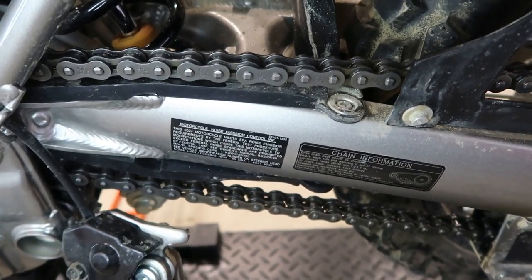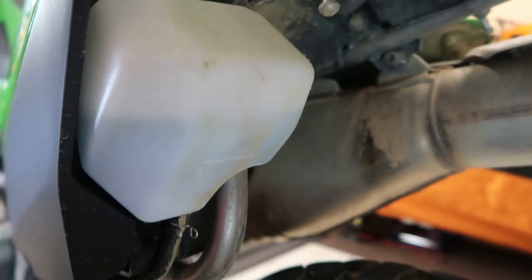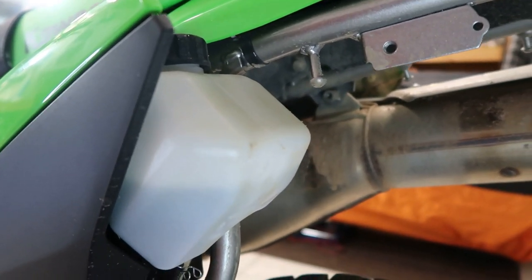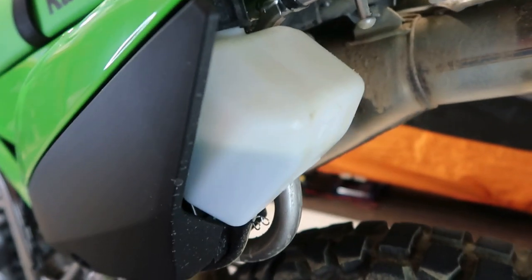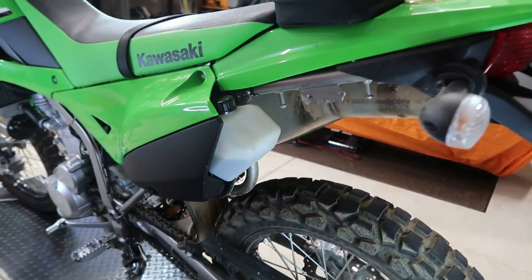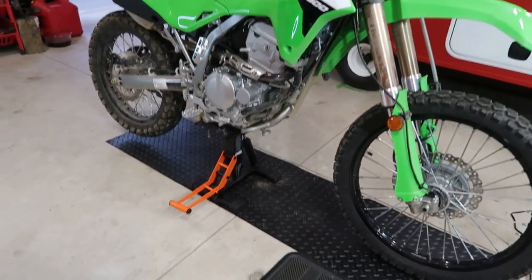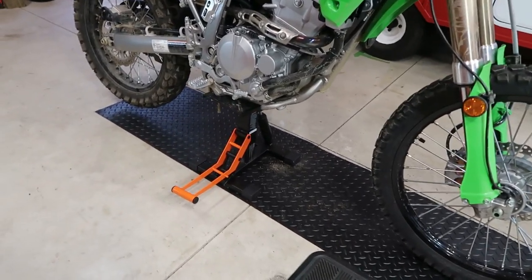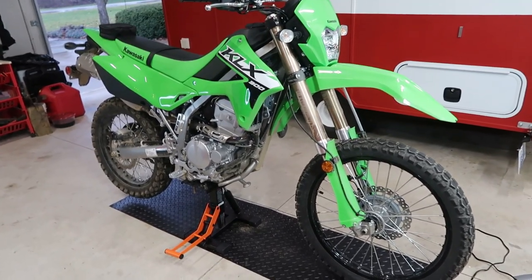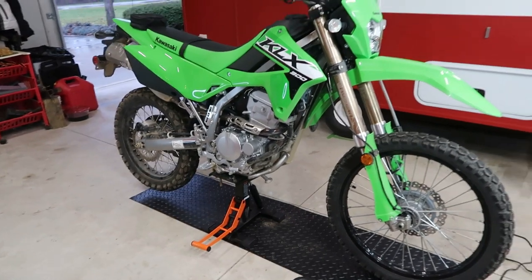Another thing to keep your eye on is your coolant. Looking at where it's at, I'm pretty happy — coolant levels look good, but I'll add just a smidge to top it off and keep it just a hair below the maximum line. A quick side note: I put the motorcycle up on a bike stand lift and that thing is a godsend — if you don't have one for servicing your bike, you're going to want to get one. This one is a Vever; I did a review video on it and I'll put a link in the description.